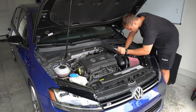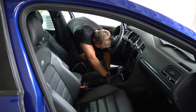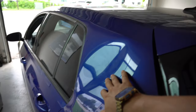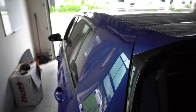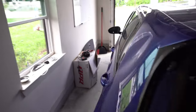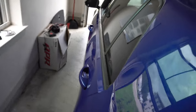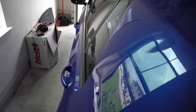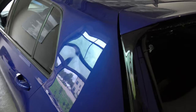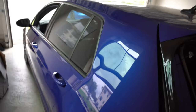With the battery reinstalled, I can finally slide the seat back, giving me access to the last two bolt holes on the seat. I also noticed a dent right here that obviously looks terrible, but since I took the back panel out there's literally a hole where I can access the quarter panel. So I just tried to push it out — and just like that, just push it out with my hand. That probably couldn't have been any easier. There's still a tiny bit left, but I pretty much popped the whole thing out.